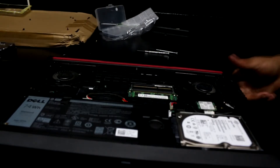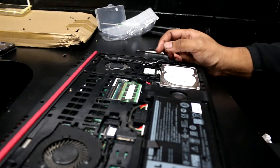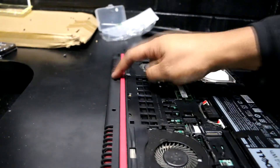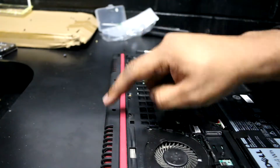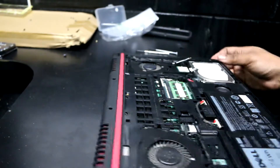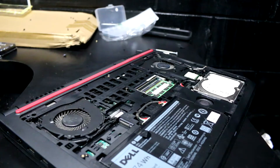I'm going to reconnect the Wi-Fi chip. Remember there are two bolts that go right here — also M2 times 5L — so reinsert those two bolts, reconnect the Wi-Fi chip, and the back cover goes on. Now we're going to see if it works.